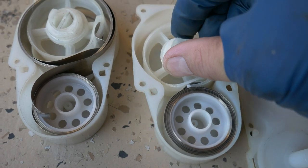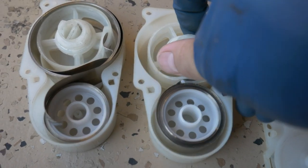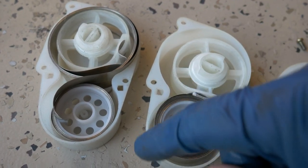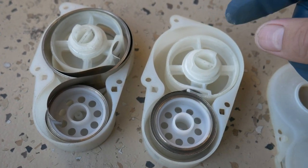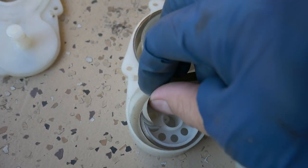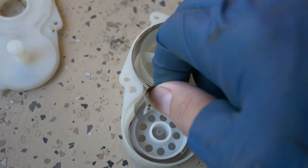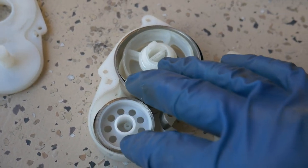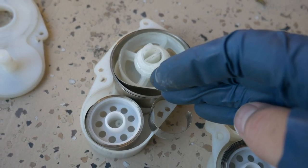Okay, this is what one looks like normally. When this is spun, this is when you pull the seatbelt away from the assembly, it spins it out, and this little coil reel will spin back and it'll pull the entire assembly back in. On the one that was on my seatbelt, it had snapped. A piece of it had broken off. You can see it was no longer, that's why the belt wouldn't retract itself in.